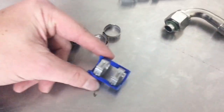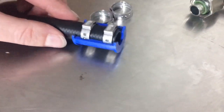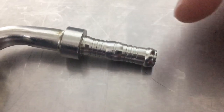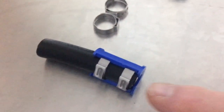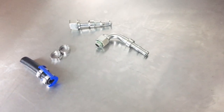We slide that over the hose — hose in there like that. You can see on this end that the blue clip has stopped there. Now the reason why we're doing this: if you have a look at the fitting, you see these two bite sections where the three pre-cut grooves are. When you crimp that in, this clip locates it exactly into where the pre-cut grooves are.